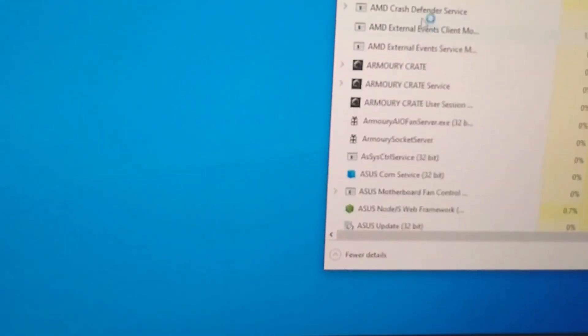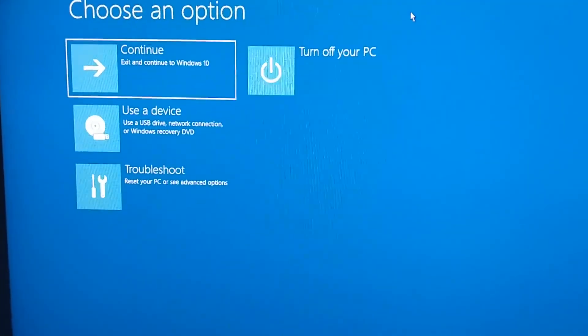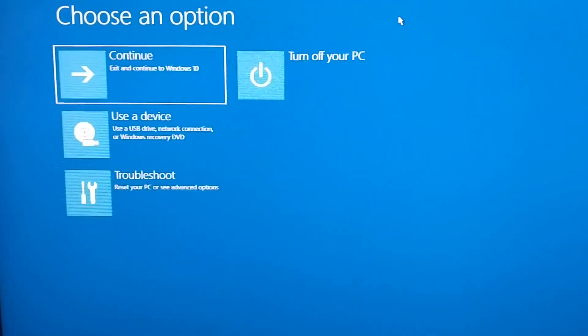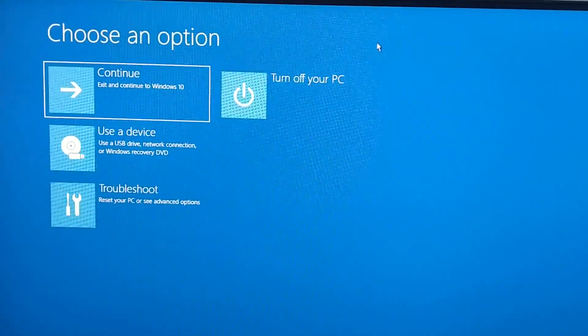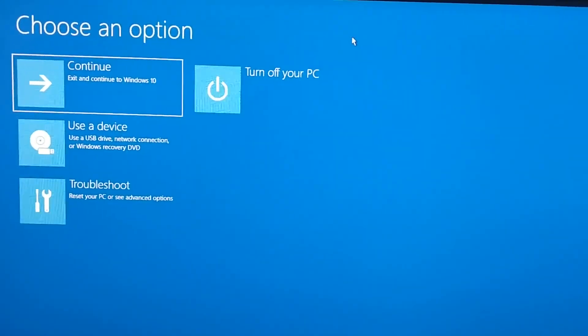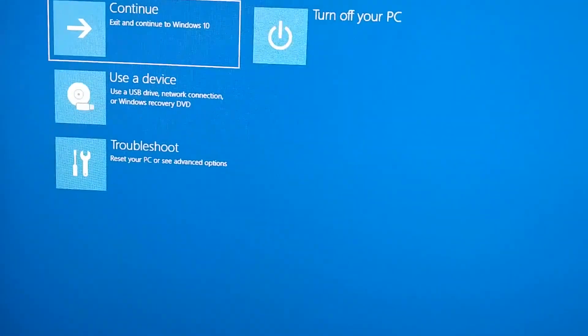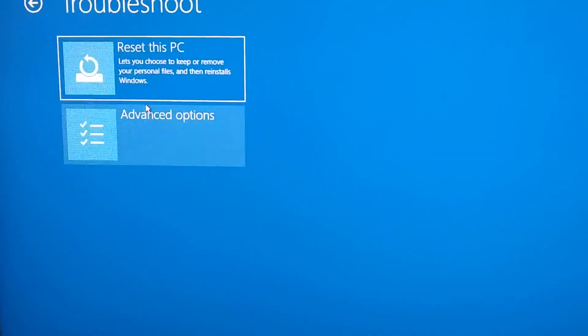It's obviously posting because it's displaying graphics but there's some sort of issue. It can't seem to get into Windows — it just constantly keeps crashing, showing blue screens, going off and coming on in a boot loop. What I'm going to have to do is put in my old graphics card, try getting to Windows, uninstall the drivers for this graphics card, then reinstall them. Alternatively I could try a system restore point.